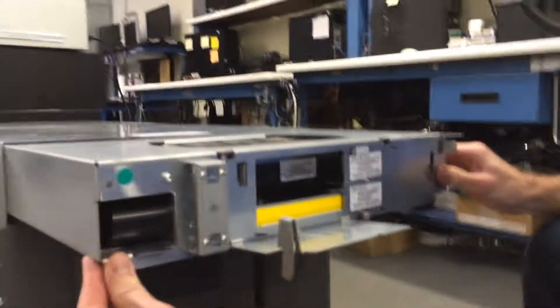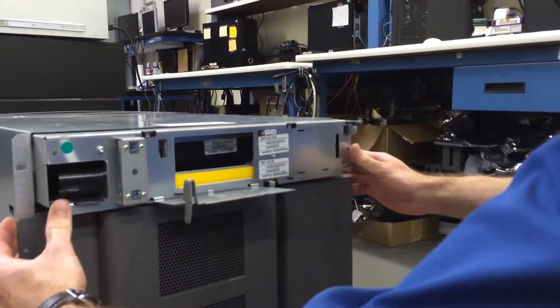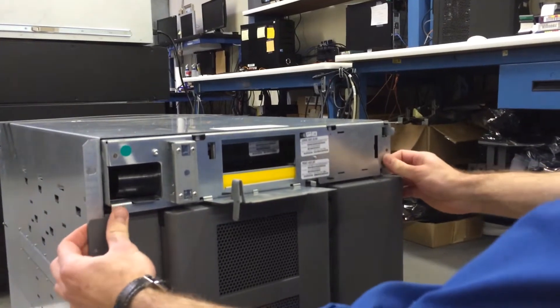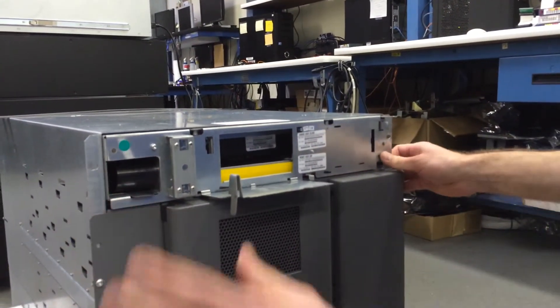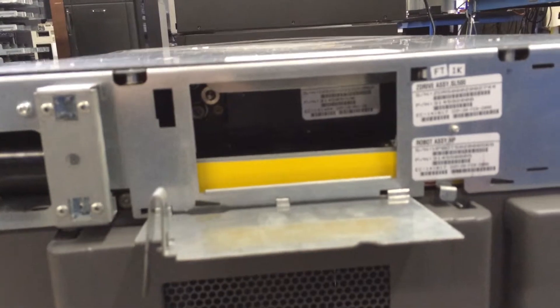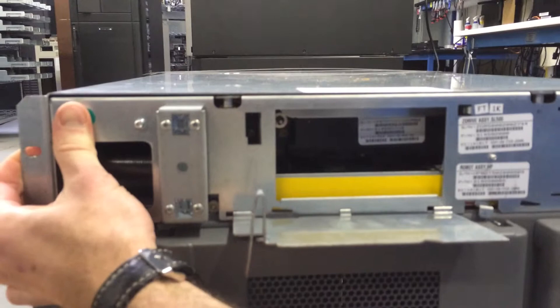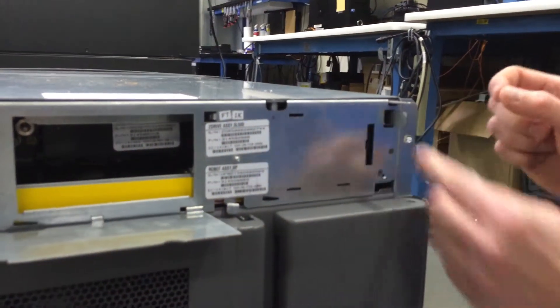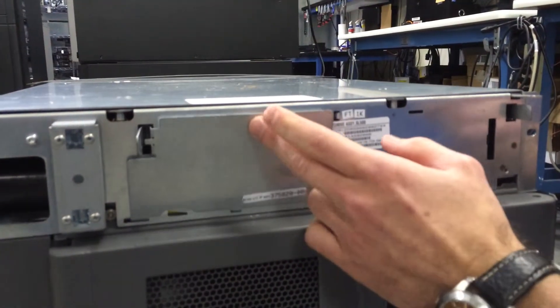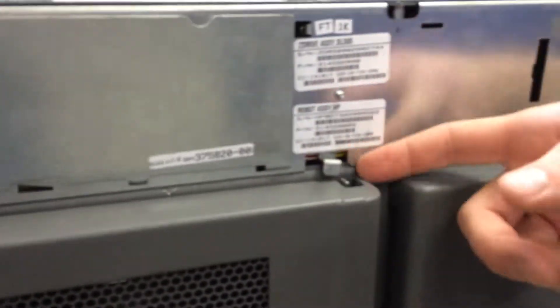After that, you start again, continue moving the picker inside the library. It requires a little bit of pressure sometimes. Just focus on this little notch right there, the door being open, everything in this position. And you just press it all the way in. The picker locks — there's a little metal tab here that locks it in position. Make sure the door is easily able to be closed. As you can see, the metal tabs of the door are behind the face plate itself.